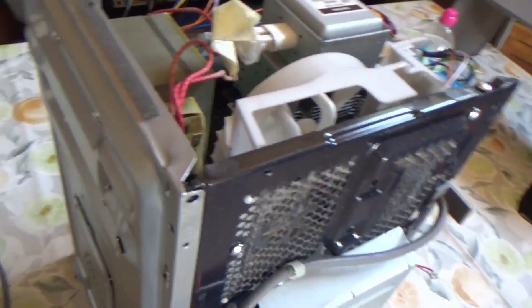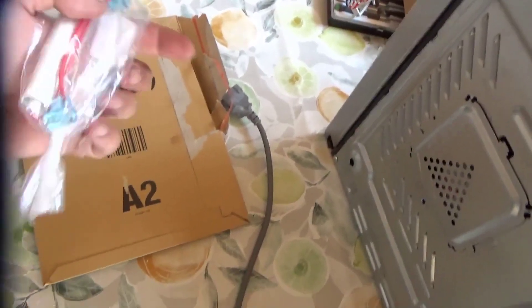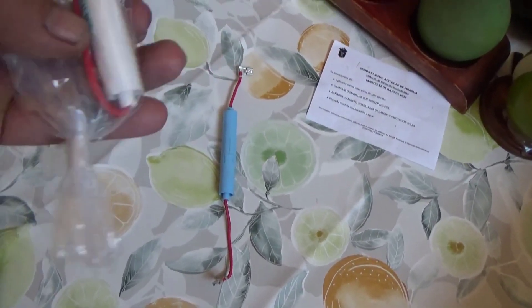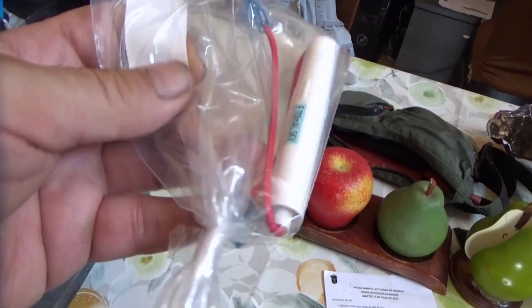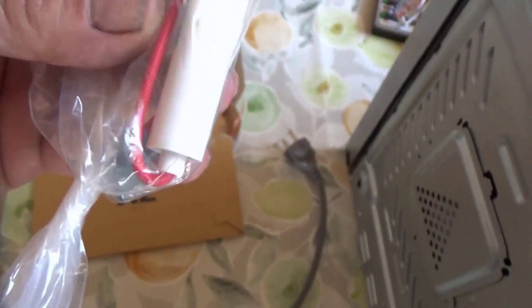Back to the microwave repair video. Yesterday when I was recording the video, I ordered this fuse and it just arrived on Amazon in less than 24 hours. The color of this head is different from the packaging, but the important thing is that it has the same characteristics: 700mA and 5000V. Today I'm not wearing gloves because we already discharged it and it hasn't been plugged in for more than 24 hours and this capacitor has internal resistance. I take it out, I put it in — one goes there, the other goes here.